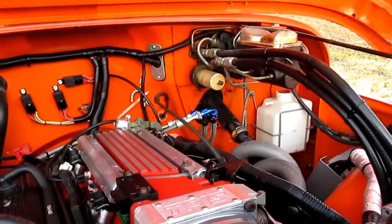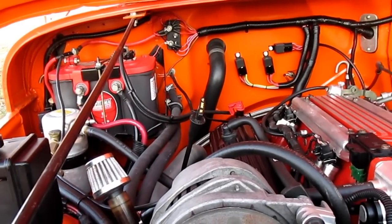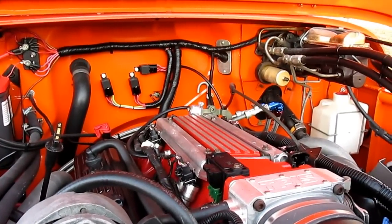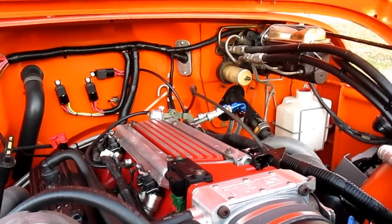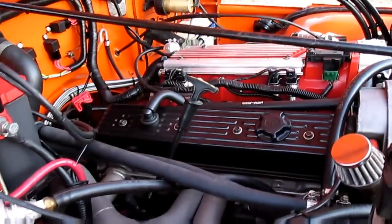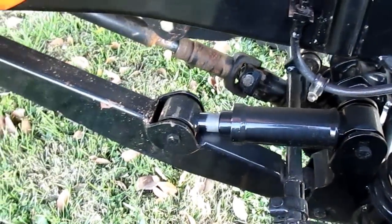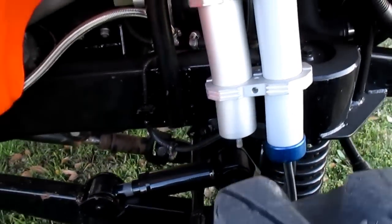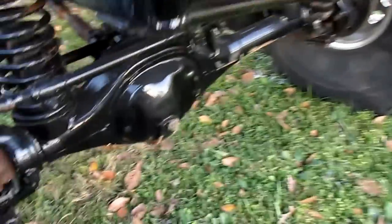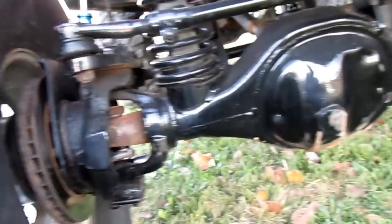Unfortunately Tom got very sick and he passed away. It was sold to a family member. They kept it for a while but they're just not rock crawling anymore. So it needs to go to somebody that knew Tom, or just somebody that appreciates a rock crawler with 550 horsepower built to take it. It's his own custom hand-built suspension — all the brackets, everything you see here was made at Sunray Engineering. The steering goes behind the knuckles, so up front you don't have any steering linkage to hit rocks.